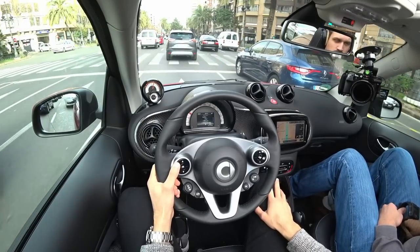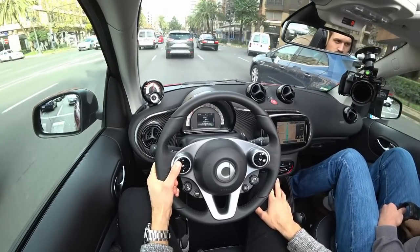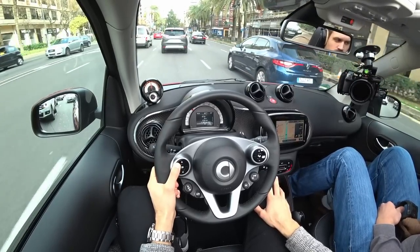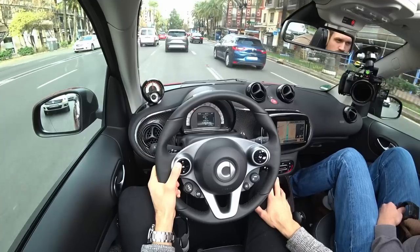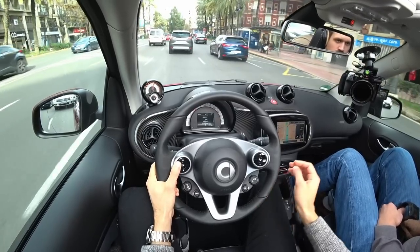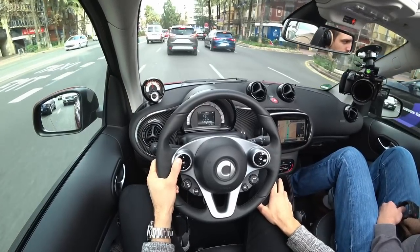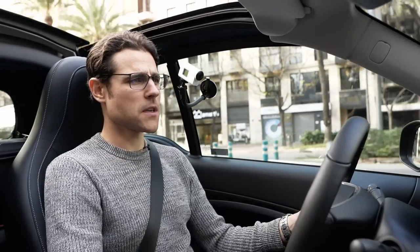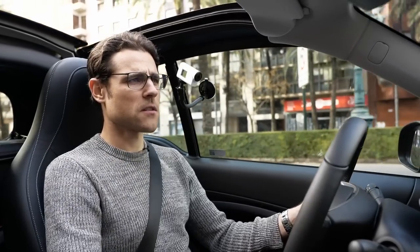And well, so far, some motorway and now city driving with using recuperation, we had an astonishing 11 kilowatt hours per 100 kilometers of energy consumption. So that would be decent. Now it's even showing me 150 kilometers of range. So that might really be the very good temperature, not using any of the electric consumers and so on. That could be a factor.